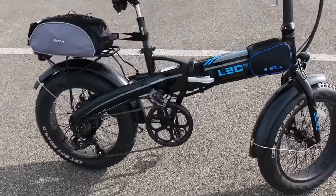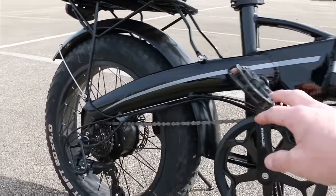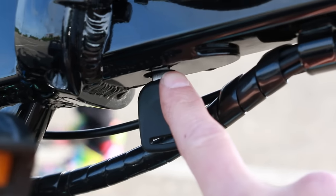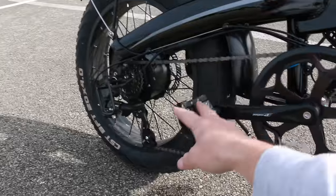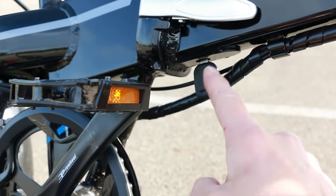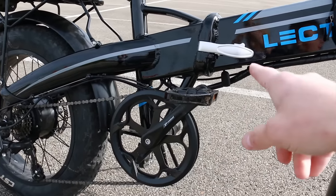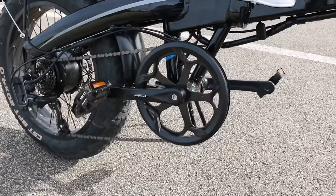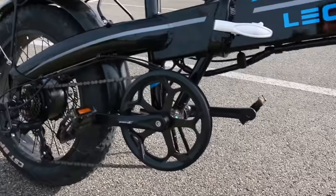One of the main reasons I wanted to make this video is to show you a few tricks about folding your bike. The key goes underneath here, and one of the main things about folding is: if you try to fold your bike with the key in and your pedals are in the wrong position, when you fold that frame in half the pedals and cranks can hit your key and bend it or break it off in the key hole. Make sure you remove your key before folding, or position your pedals so they won't hit it.